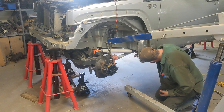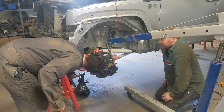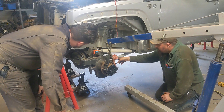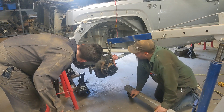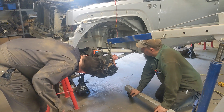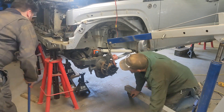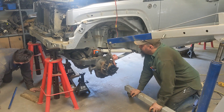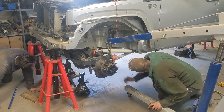This is almost all the way out back here. Yeah, there's a lot - it's tipping forward hard. But we also really need to drop the other side away because you're going to have five inches of up, that gives you 11 inches of droop. So that side's got to drop seven inches to accurately represent the angle of the axle. Look at this - this is looking really good. That clears fine. Even if it was straight stuff, it won't hit. Yeah, that's why I put it where I put it - good clearance here.